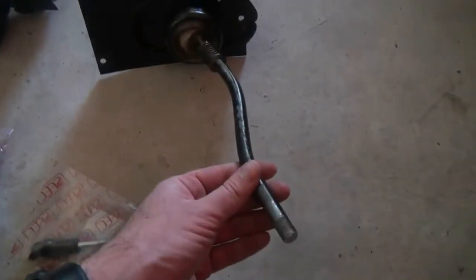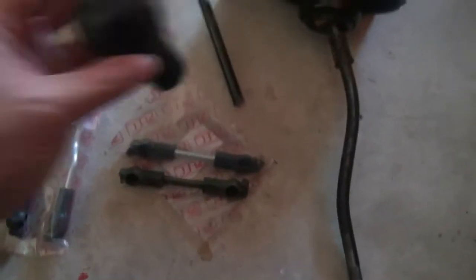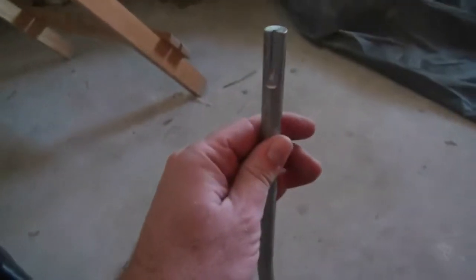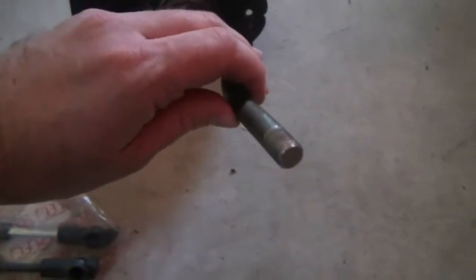So I've got one of two choices. I can either remove the gear lever completely and fit that into this housing. And why do I want to do that? Well, I can't put my gear lever on. You'll see the modern Citi Golfs have a different way of hooking the gear lever handle on. Whereas the old ones were threaded, the new ones aren't. I think you sort of push down and twist.